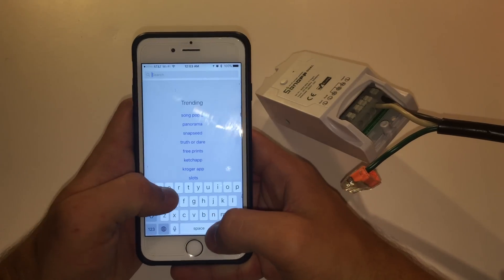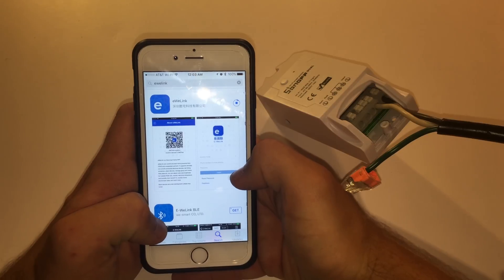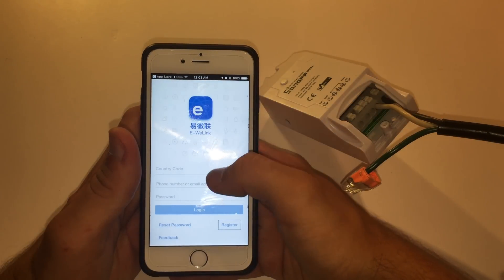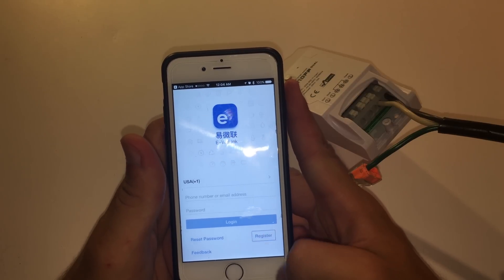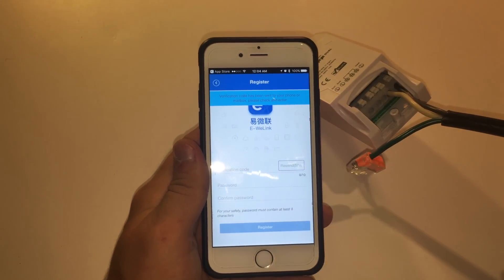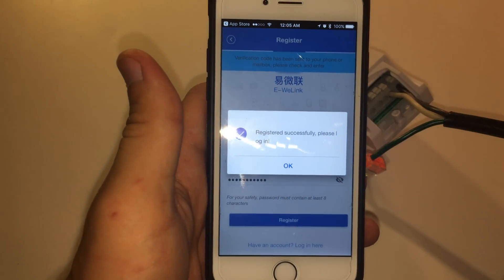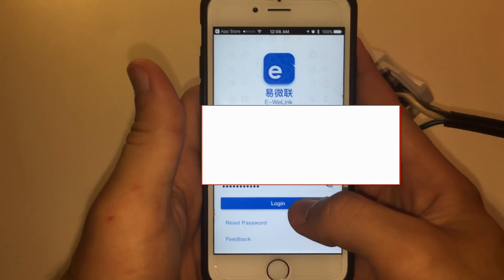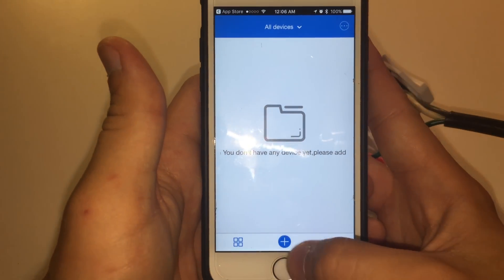The Sonoff is now connected to the power cable. Grab your phone — Android or iOS — and go to the app store. Search for eWeLink and press search, then click install next to the one with an 'e' in the icon. Once installed, open the app, allow notifications, and press next. It will ask you to login; if you don't have an account press Register. Enter your email address, press next, then enter the verification code sent to that email. Type in a password twice and press Register. It will say registered successfully — press OK, then log in with your email and password. Once logged in you'll be on the devices page — click the plus button to add a device.